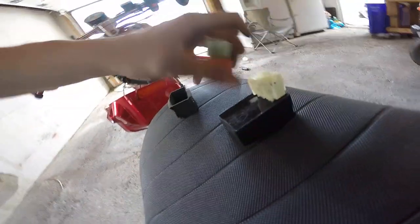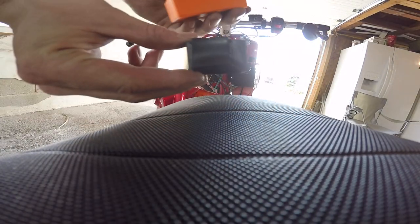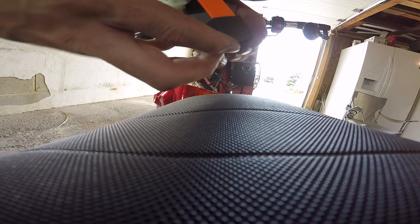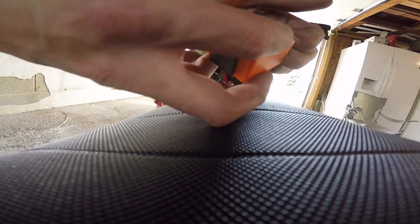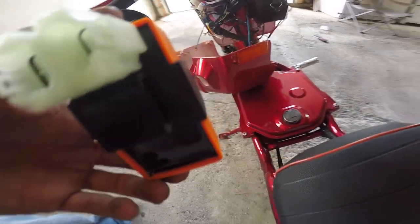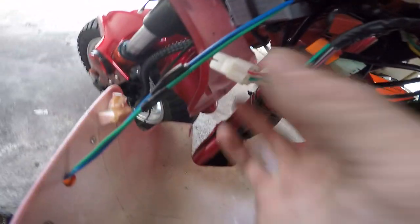Now wrap the plastic rubber holder back on the new CDI — slide it on like this, stretch it a little bit, wiggle it in place, and slowly inch it back up. Take it about 75 percent of the way up because you can't get past the prongs anyway. Then look at how it mounts — there's a little side holder here, and you can just wiggle the bottom one on, then flip it over to the top.